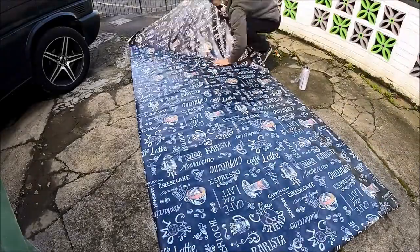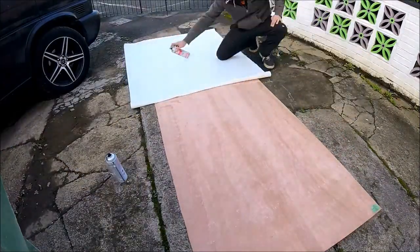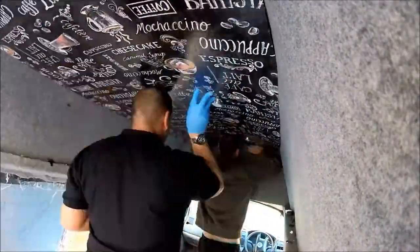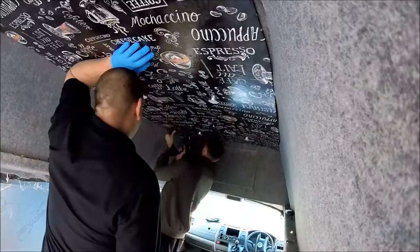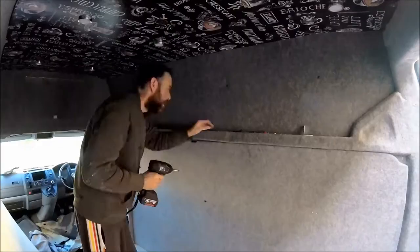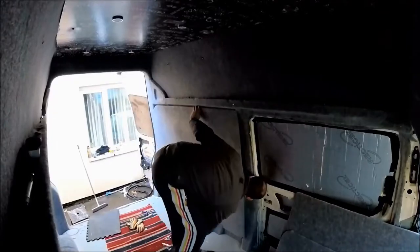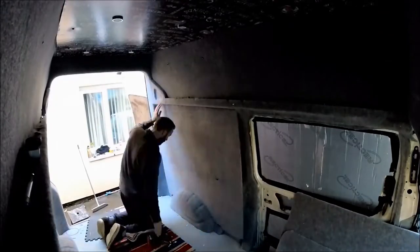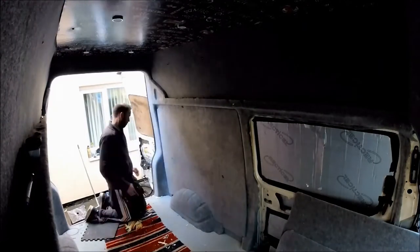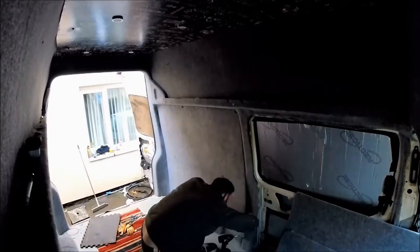To break up the interior, new headlining was made and vinyl was applied to it. Getting the new headlining up is a two-man job initially, because there are no previous mounting holes or brackets. Once the headlining is in, it's a case of applying all the carpeted panels back inside. If you screw any carpeted panels into the metalwork, make sure the screws aren't going all the way through and piercing the outside skin of the van - use nice short screws just to pierce the inside of the mounting frame.